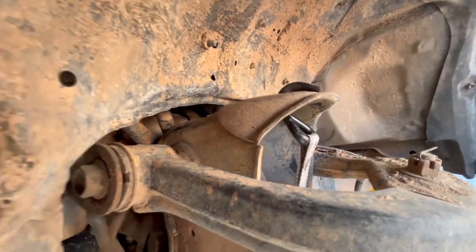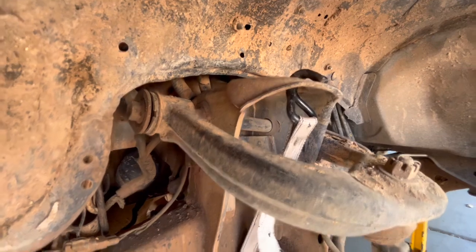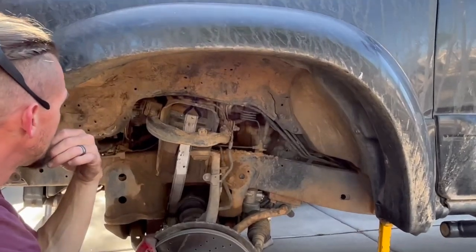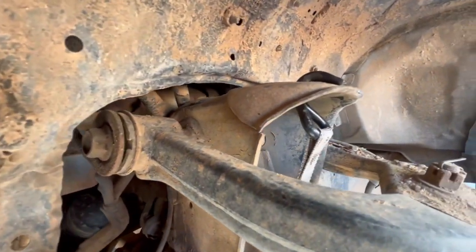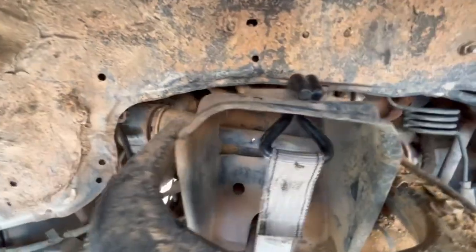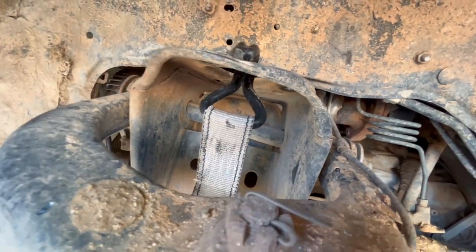So I want to see if I can clean it up and put some welds on it. See if you can break it this time, good luck dude. It looks like we're gonna have to take this control arm off because to get at this crack here fully, this is in the way - really just not going to be able to get a proper job on it. Looking at it closer there's a little split right here too, and it's going on the other side as well.